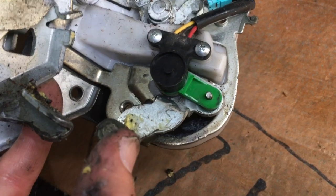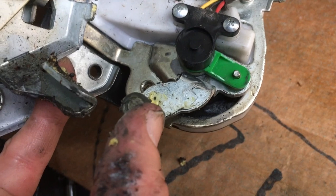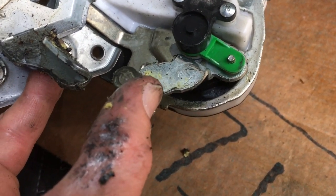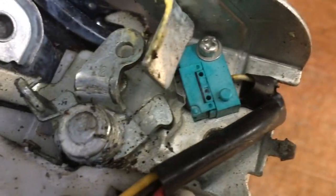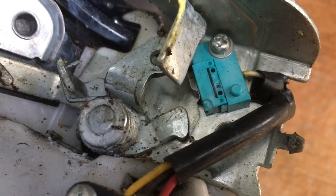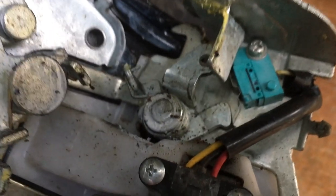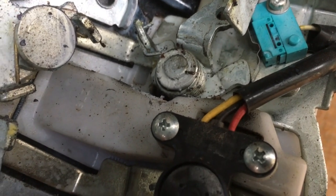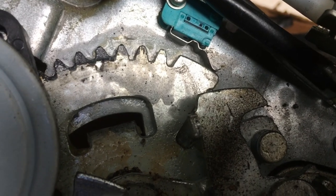One of the things I'm hoping to solve is just that the car will know that the door is actually shut. My theory is this pin is probably the locking pin. When it's pushed over, watch what happens up here — the blue switch is activated. So if that is gummed up and it's not making contact with the switch, the car is not sensing that the door is closed. That's my theory and the same thing is true over here, so that's why I am lubing everything.